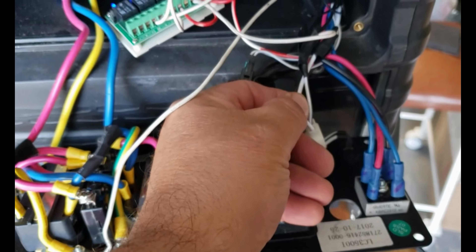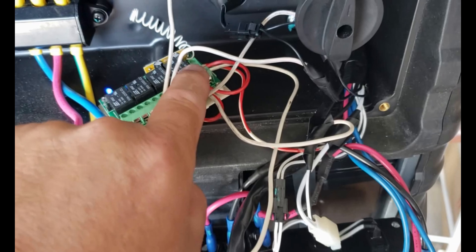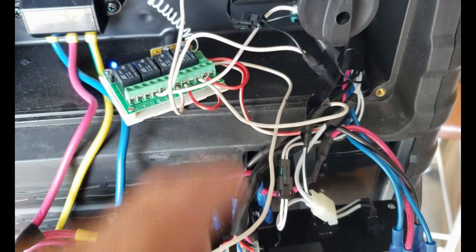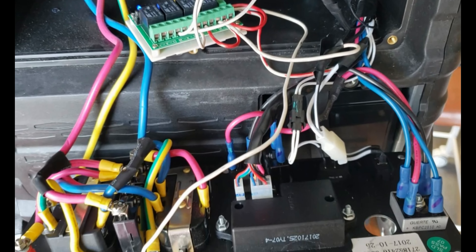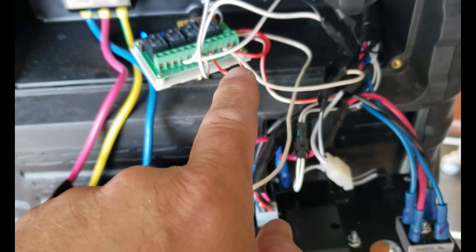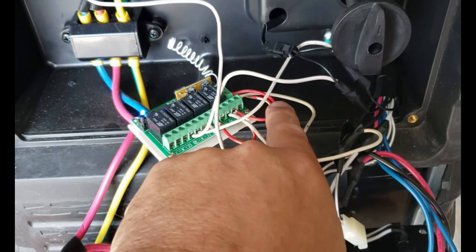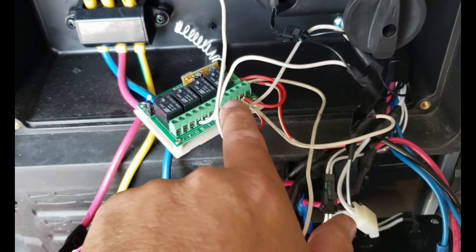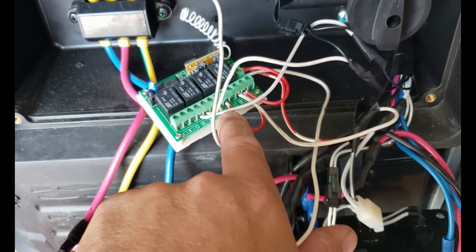Let's see how the remote control is wired. First you need 12 volts going to the board. You could take it from the battery, but I decided to take it from the start switch — this white connector. The white lead going to it is the positive. You do have to tap on those two wires to activate the starter button. So instead of getting the positive from the battery, I tap on the white wire which is the positive and feed it up to the positive of the board.